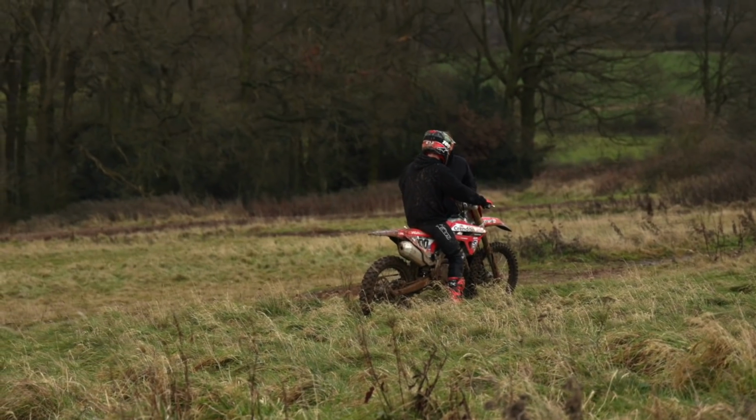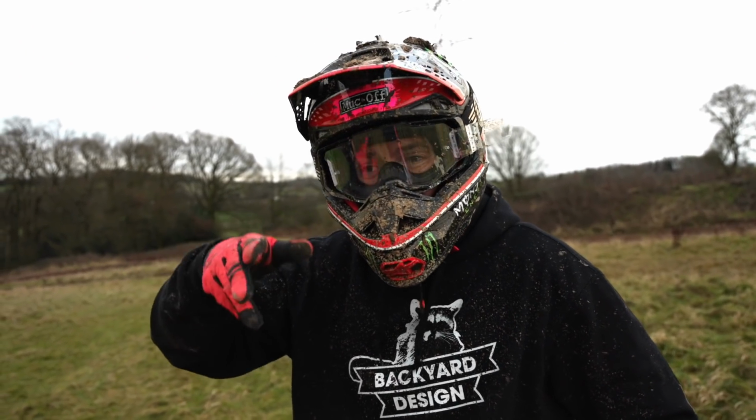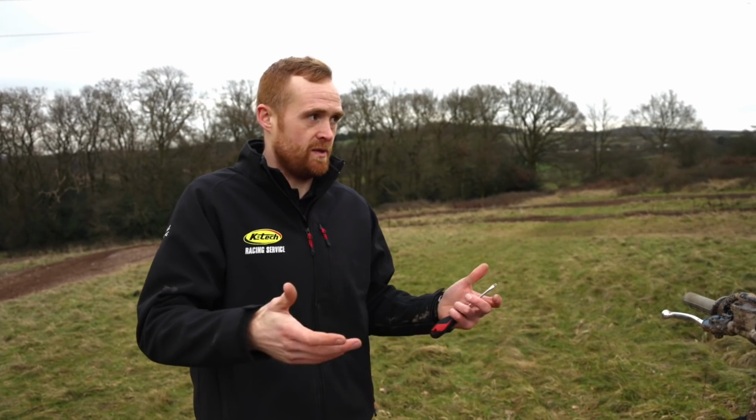Similar to what I said in that first video I did, but now I just want to get a bit more feeling, so I want it to hold high, but I want to have the feeling. So what did we change? On that one, when we first went out, we opened up the rebound 3 to 4 clicks, just to let the wheel move. And then we've gone in on the high speed again, just to let it hold up some more. Because it's a really underused thing in suspension, that high speed adjuster, pretty much no one will touch it.